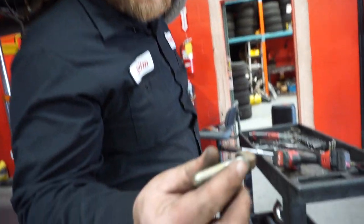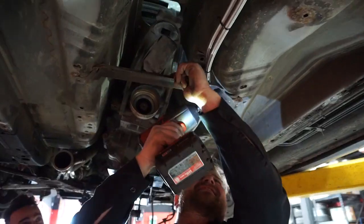They hold it down. You guys see this right here? This one is actually on the side that goes from the motor and threads into the bell housing. Right up here. Oh man, thank you Azuri for finding it. It goes right up there. Let's see if we can get that in. Come on this way. Yeah, so it's on the opposite end of this flush part right here. It's shorter than all the other bolts, so don't mix them up. Very important. Keep it even.